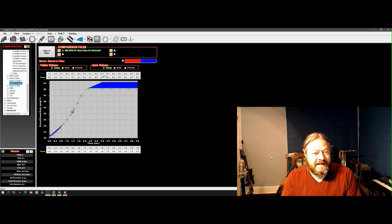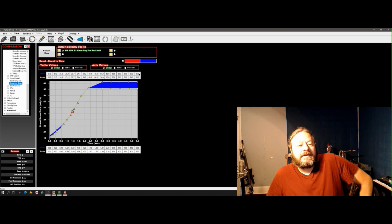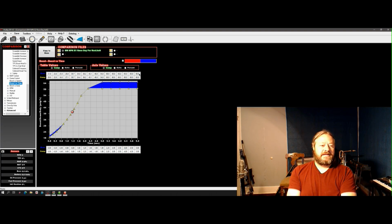And then out the back, in addition to the timing, I added 5 pounds of dome. I know where we're at. I know it'll make a little more power. Not a lot. We're at the end of this turbo, but may as well use what we got if we can. And that's what we're doing. So it should make a little more boost, a little more power out back, a little more in the front. And I feel like that's going to be a relatively safe adjustment. So let's take that to the starting line and see what happens in E2.